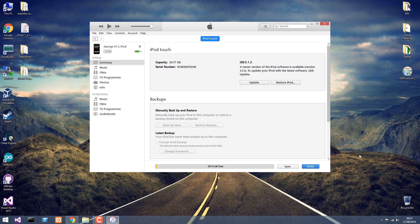The problem is that if you're trying to do this project, it doesn't matter what device you have — the original files from the iDroid project support only up to iOS 4.1. Whatever device you have, downgrade it all the way down to iOS 4.1, or even past that if necessary. In my case, the first generation iPod Touch doesn't support iOS 4.1, so I downgraded it to iOS 3.1.2.